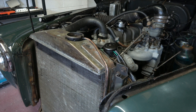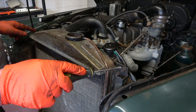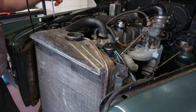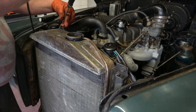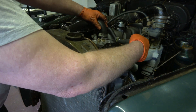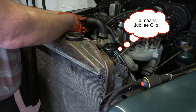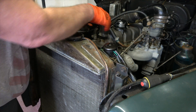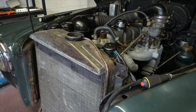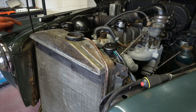While the last few drops of coolant are coming out I might as well remove this hose first, and then we'll remove this support bar for the wiring bits and pieces. Actually this hose is a little bit too small - not this one but that one - there's hardly any thread left, so I'll replace that one when I come to put it back together. Right, that hose has been removed.